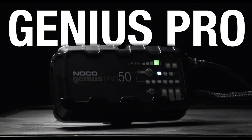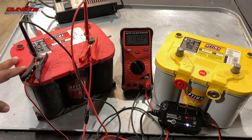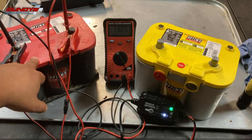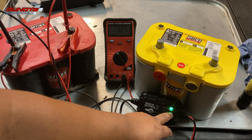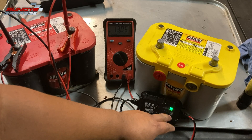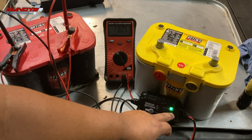It's about 8:30 at night so let's see what happens — it could take a couple of days, who knows. It's Sunday about 8:30. I didn't know what to expect, but it's been about 26–27 hours that this Optima battery has been hooked up to the NOCO Genius 5 charger, and it looks like it's coming back to life. If it were fully charged, the green light would be steady green, but it's doing that blinking, dimming in-and-out green — that's its final conditioning cycle.